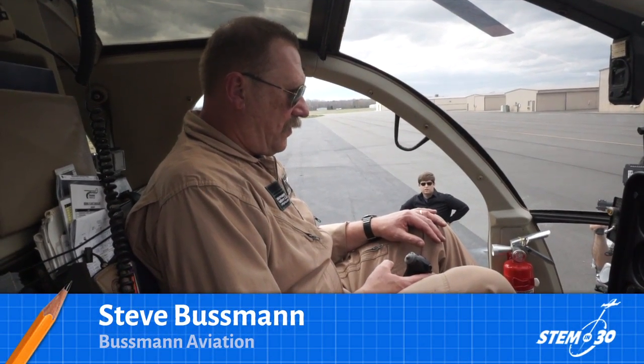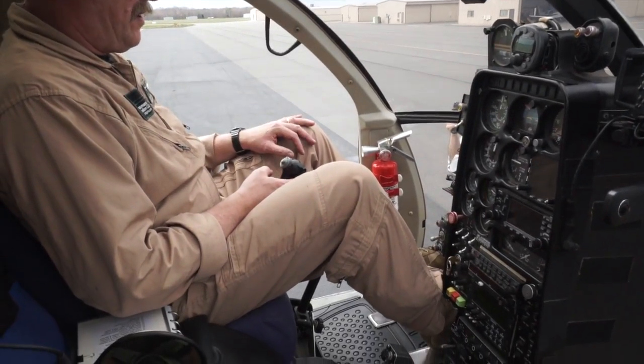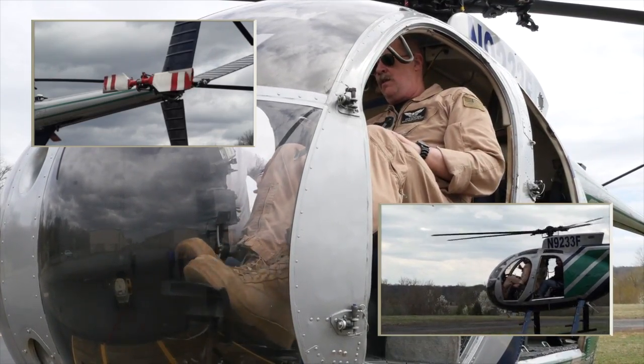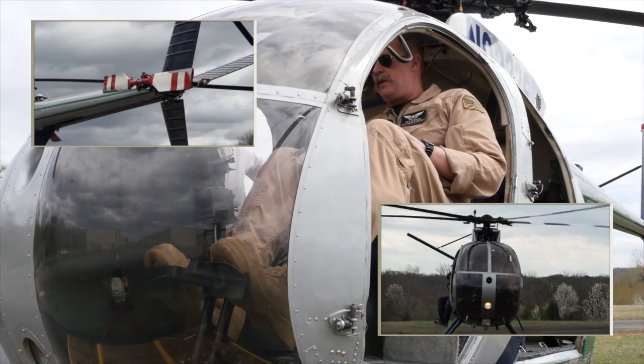There's a total of four flight controls the pilot has to worry about. The first is the tail rotor pedal, which are operated by both feet. This is how we turn the aircraft in a hover. If you move full right pedal, you look at the tail rotor — it just adjusts the pitch of the blades. Full left pedal. And then once we're in forward flight, the pedals basically become neutral.